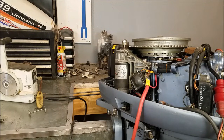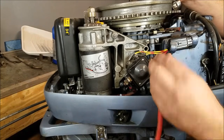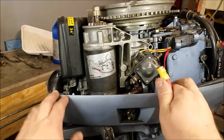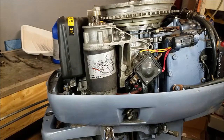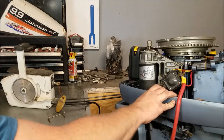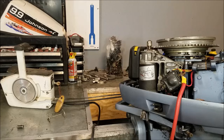I'm going to show you the absolute laziest, worst way to test this out. I have a hot positive wire here. Pretty good chance our solenoid needs to be changed. Starter works fine — needed a solenoid. And that really is probably the easiest way I've ever found. The problem is it kind of leaves some little charge marks where your cable hit the nut here. Who really cares though, you know what I mean? So, solenoid, and this thing will work again.